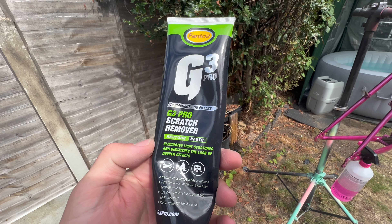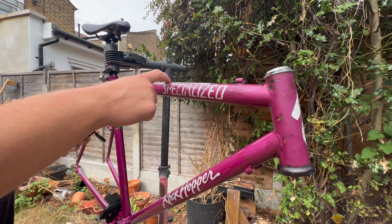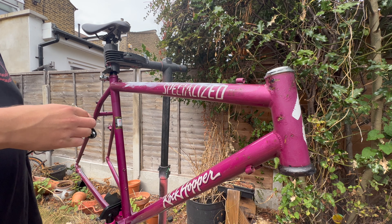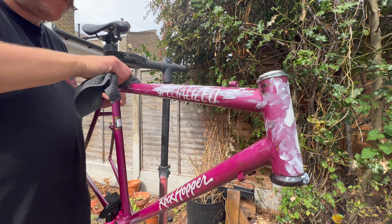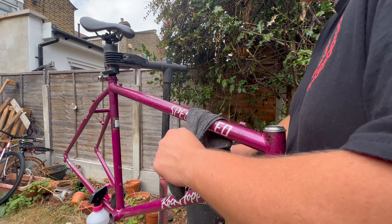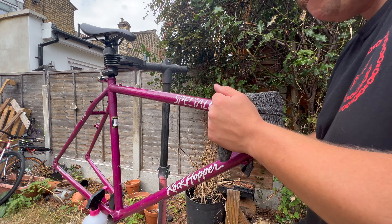For anybody who's ever restored the paint on a frame or a car before, you know it takes forever - so I'm not going to make you watch the whole thing. I'll just focus on the top bar to start with. I basically use Muc-Off just because it's got that washing-up liquid type deal in it - it gives you a bit more lubricant when you're wet flatting. I went over it very lightly with a very fine 3500 grit and just took a little bit of the edge off. I did have to do quite a bit on the top because of the rust converter, but I won't do that again.